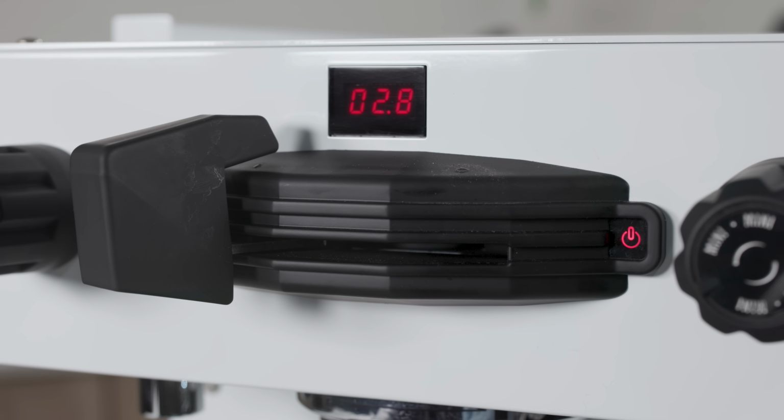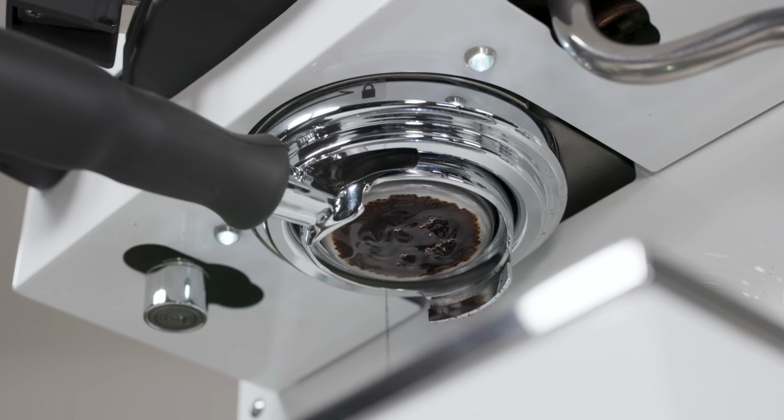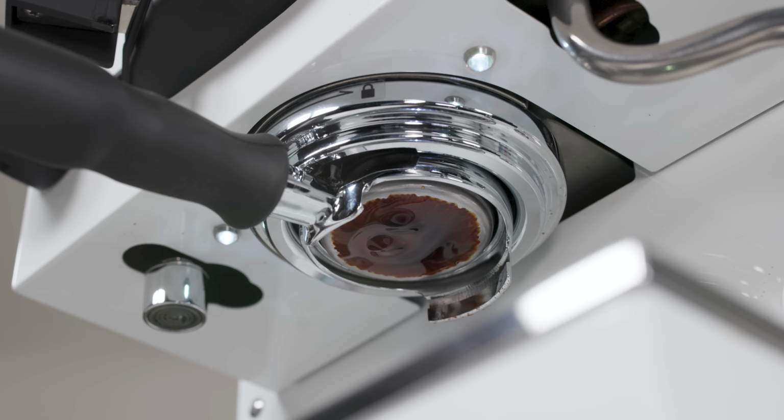We did 6 seconds, the pump was running, we pressurized the puck, we got the full saturation of the puck, and we allowed it to sit there and bloom with waning pressure. Of course, the pressure is going to decrease because, well, the basket's on a closed system. There's a ventilated side on the bottom where it can dissipate pressure. So as the liquid's coming out, it's depressurizing, but it's not unseating because the pressure is only being able to escape that way. It's not able to get back into the machine. So it allows for really nice blooming shots.